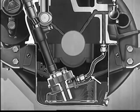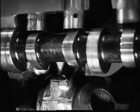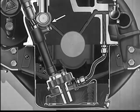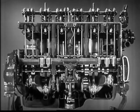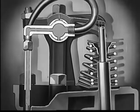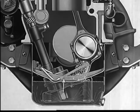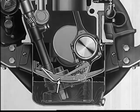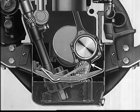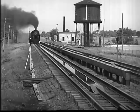To get this lubrication, a constant stream of oil is pumped under pressure directly into the main bearings. The camshaft has the job of opening and closing the valves and needs an elastic cushion to protect it from friction. The oil flows through tubes to the bearings which carry the camshaft, and more oil flows out through a nozzle under the timing gears which drive the camshaft. To keep the valves in smooth operation, oil is pumped up into the valve mechanism. A special method is used to lubricate the connecting rods. A high-pressure stream of oil is forced through nozzles in the base of the engine, and each jet of oil is accurately aimed to strike a scoop or dipper on the bottom of a connecting rod.